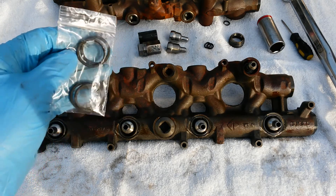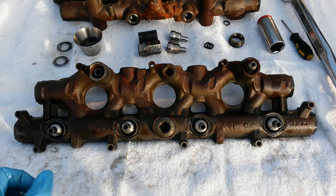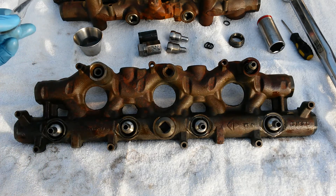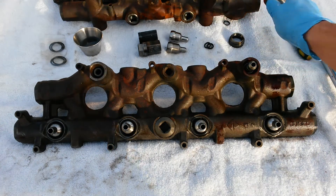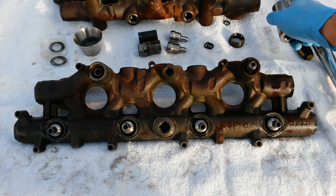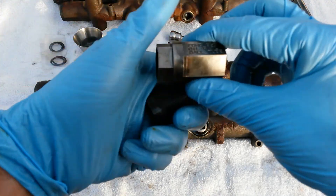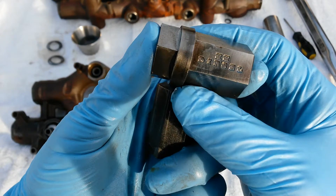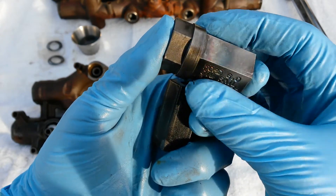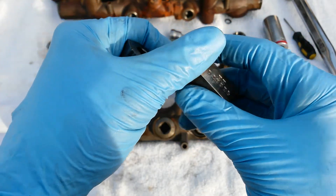I'll put a link down below in the description. I also sell the tool for getting the lock nut out. You're going to need your O-rings and the tool — those are the two main things — as well as a 23mm socket, which you can get at AutoZone for about $7 or $8. As far as tools go, I would recommend the tool made by H&H Diesel. It's really top-notch, high quality, made out of hardened 4140 chromoly steel.